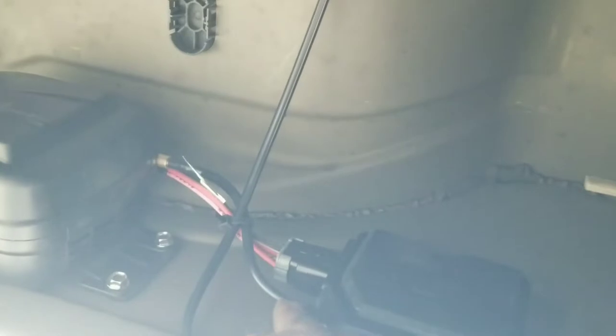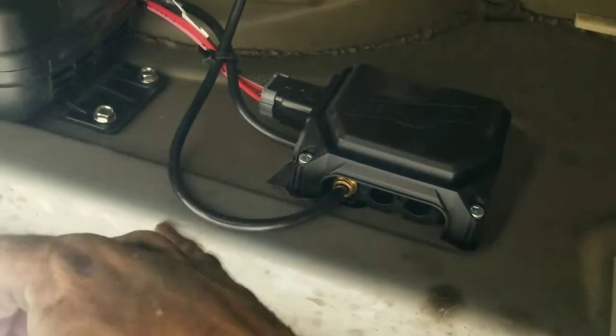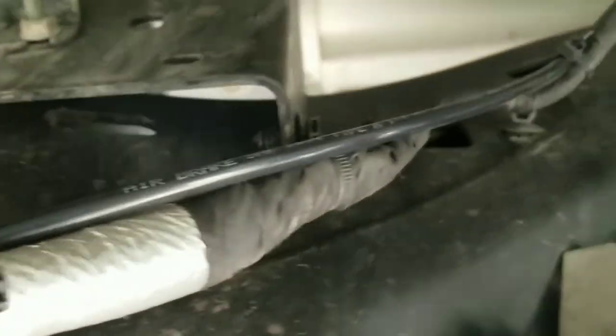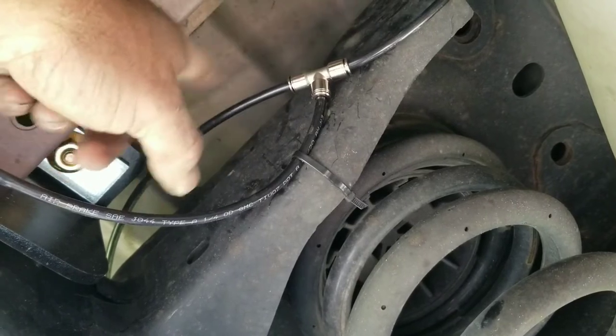The airline from the compressor comes around and goes into the one by the plug. This one goes to the airbags — I didn't really like doing it that way but that's the best way I found; I may get a piece of rubber hose to go out there. Then it came up and over the frame. I like that a lot better than what I did with mine — ran along the top side and zip-tied to the factory wiring as much as I could, then came around and went into a tee right here that splits between the two airbags and tees from one bag to the other.